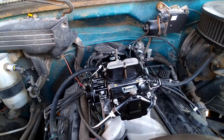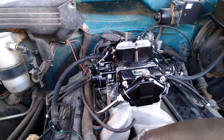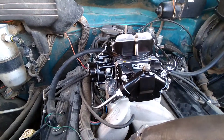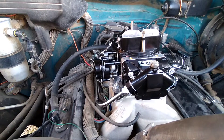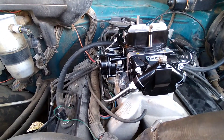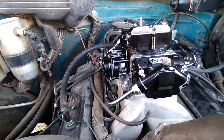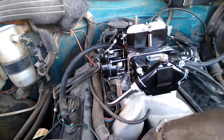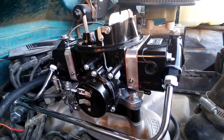Alright guys, I jumped ahead a little bit. Went ahead and unboxed the fuel line. On these fuel lines I always put a little Teflon, because every one I've ever had leaked. We got everything bolted down, got our linkage hooked back up, and we're about to hit the key to see if we've got any leaks — probably see the fuel bowls fill up, maybe.